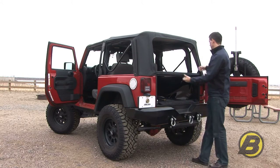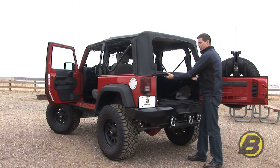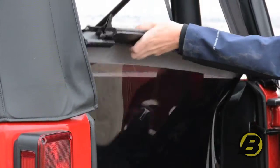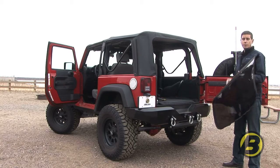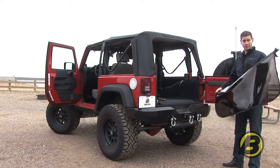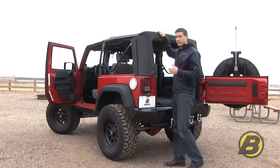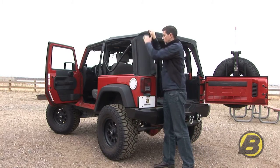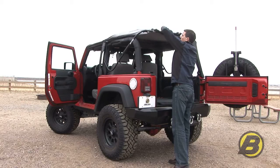Once you've released the zipper you're then held in by the tailgate bar. Take the bottom edge, pull it out, and roll it towards you. At that point the whole window comes out. Again, as with the quarter windows, store them somewhere safely so they can't blow out and won't get scratched. Once the windows are removed, pull out the sail panel — a little bit of pressure pulling down on the bow, pop it out from the channel and then fold it up onto the top of the deck.